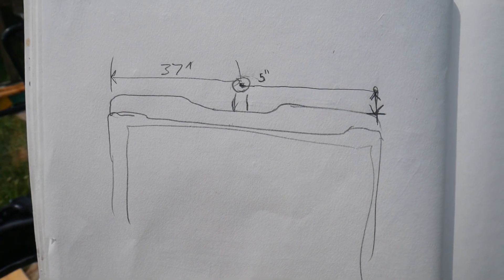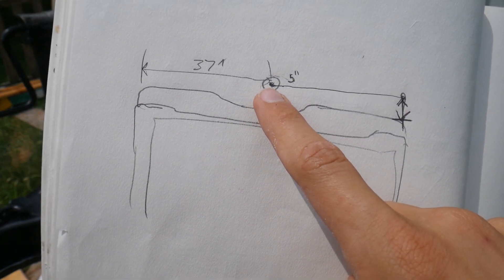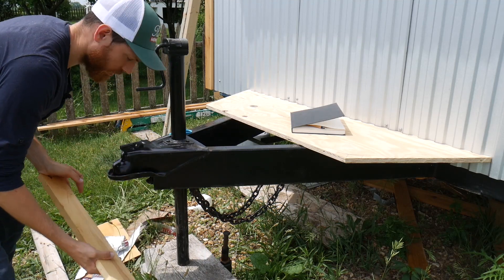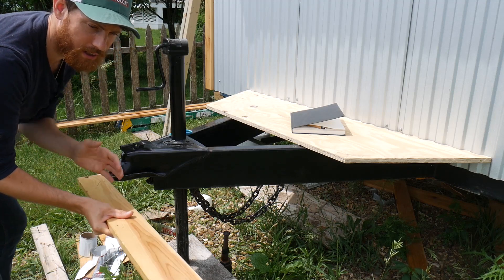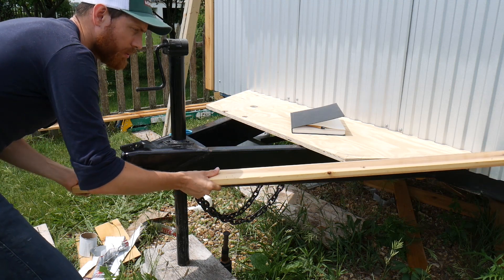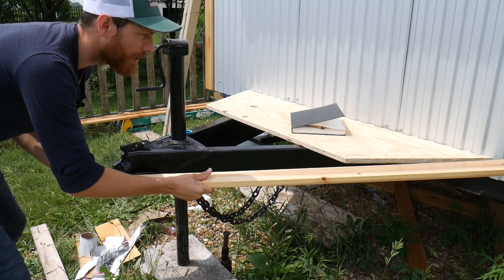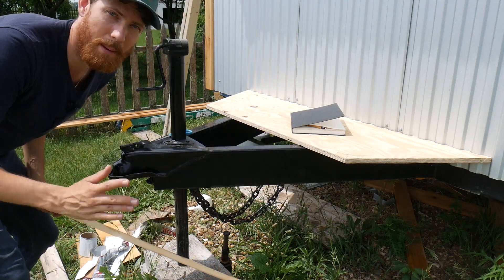This is the bumper of the truck I'm going to be pulling this with — the hitch comes out five inches from the back of the bumper, and the bumper goes out 37 inches on each side. You can do a mock-up with a board, coming out five inches from the hitch ball and marking at 37 inches, then turn and see where you'll be. In this case I'm maybe sacrificing five degrees of turning radius when backing up, but I think that's going to be okay. If I get really paranoid I can build a metal bar bumper in case I back into it.